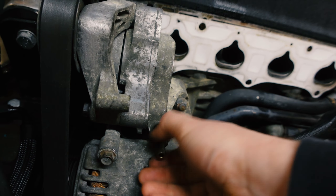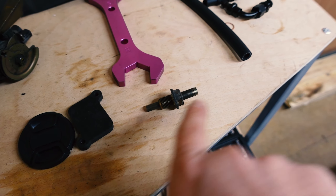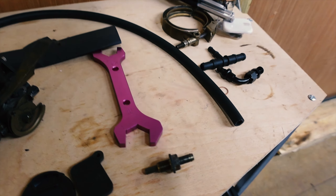The fun one that didn't come out for a while was this: the check valve on the lower crankcase, which you can get off with a 17mm. This should only be a one-way check valve — air should be able to travel this way, pushing any crankcase gases out of the block and back into the inlet manifold. Under boost, there's a spring in there that closes the valve. The problem was the valve had failed.